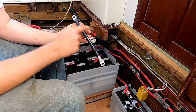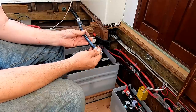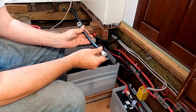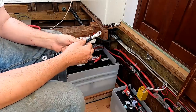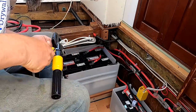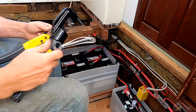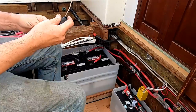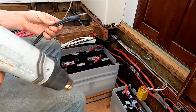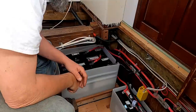It pays to, on a short cable, align the rotation of the lug to roughly where you're going to use it, because you'd be surprised how hard it is to twist an eight-inch long cable. Because these both go flat, we'll put it right like that. That's awesome. Very nice.